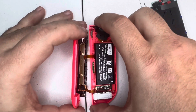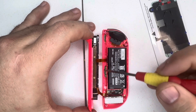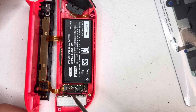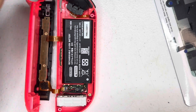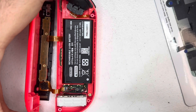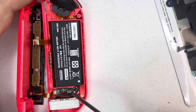I'll show you the cables that could get damaged if you open it the wrong way — this cable right here and this one right here. That is why we need to open it like a book. You can disconnect the battery if you want, but I suggest beginners do not, because this port is notorious for breaking if not removed correctly. It's not necessary as long as you are careful while working inside.